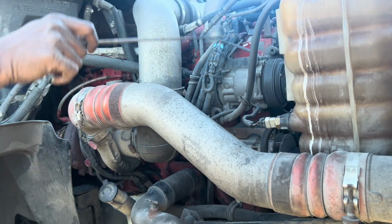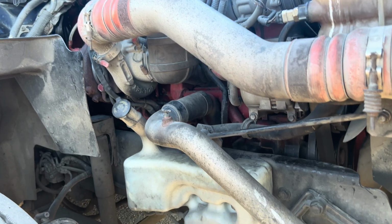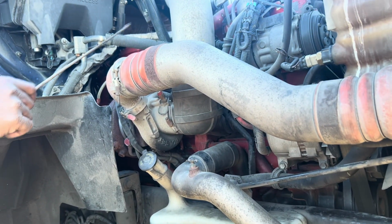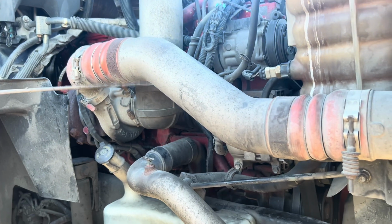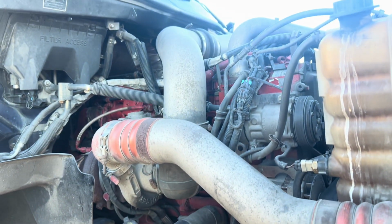Then I'll give a general overview. Check all my hoses and my wires. They are mounted and secured to the vehicle, not bent, broken, or cracked. You say no abrasions, bumps, or cuts on the hoses, and I detect no leaks on the hoses. And I detect no burnt wires. All my wires are intact, they're not burnt.